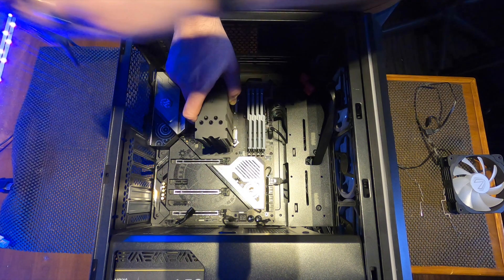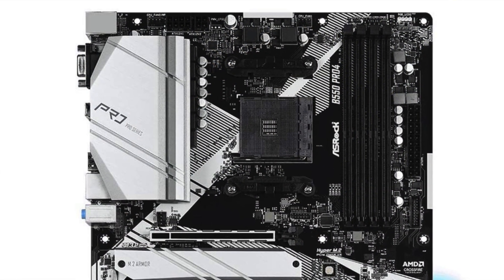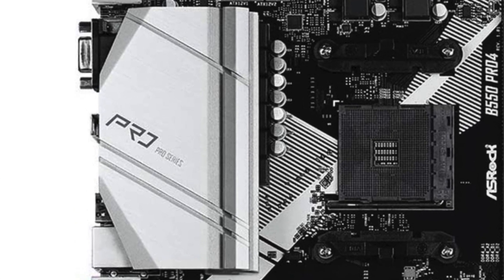If you're running an AIO, there's always going to be a danger of a leak. Leaks won't necessarily destroy your expensive computer depending on where they are, but glycol coolant around electronics is not good. If this cooler were to fail, you still have an enormous amount of copper directly on the CPU — many CPU coolers back in the day were completely passive with no fans at all. When an AIO pump fails, you often won't know until your motherboard's protection takes over, and you can still have damage to critical CPU areas. If a fan starts to fail on this cooler, you'll usually hear it, see it, and can replace it. Your AIO's pump is almost always not serviceable, so a dead pump 13 months in means buying another entire AIO. Lastly, many motherboards were designed to have cooling airflow over the CPU area to help keep the VRMs cool — if you just have an AIO pump and remote radiator, your VRM temps will be higher. Those are just a few reasons to choose air cooling over more complex radiators.